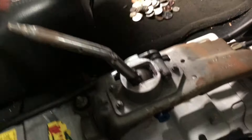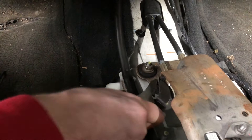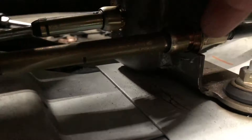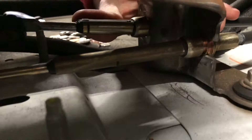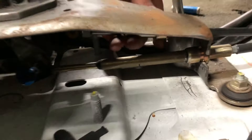The shifter is pretty loose now. There are C-clamp clips on the sides that have to come off, plus the cable up front. There are two C-clamp clips — or U-clamps — that hold the shift cables onto the shift base itself. Now we're removing those and then taking out the bolts. The instructions say they're 10mm but mine are 13mm, so just figure out which size yours is.